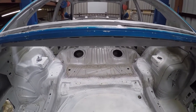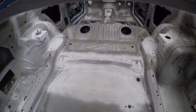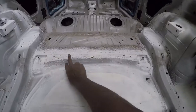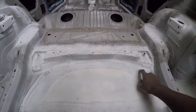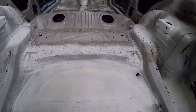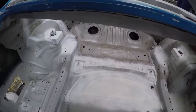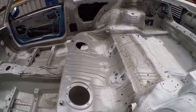The subframe has been reinforced at the bottom with a plate. I also created a reinforcement for the front and rear — this bar which I've welded in basically picks up the two subframe points. I've used the longest subframe bolts to come up through the floor. This bar is now welded into the car and it just supports the two subframe mounts at the top.